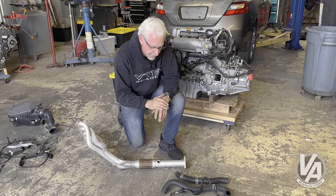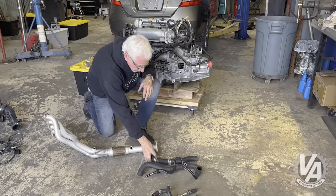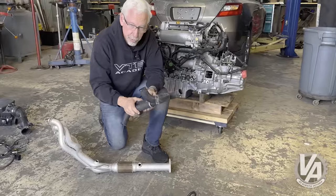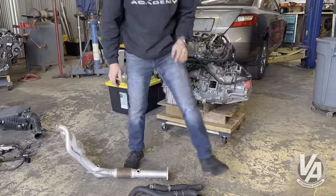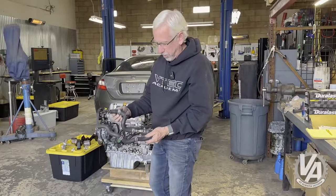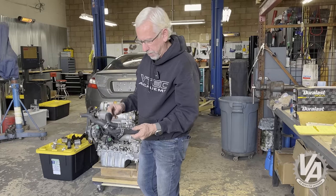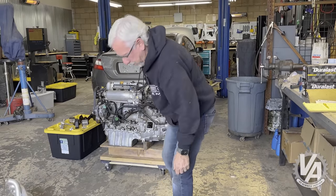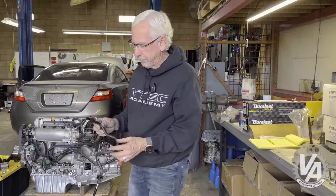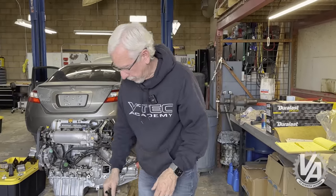For the radiator hoses, you can use a stock radiator — it works just fine, same as the SI radiator. All we had to do is buy SI upper and lower radiator hoses from Honda; they're pretty reasonable. We also needed the heater hoses, so we purchased those from the SI as well. We were able to use all the spring clamps from stock and only had to purchase two additional hose sections. That brings us to the fuel line — this is the fuel line for the SI. I actually cobbled together something else using adapters, but I don't suggest that. Just go out and spend $30 and get the one for the SI.